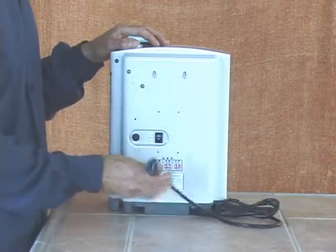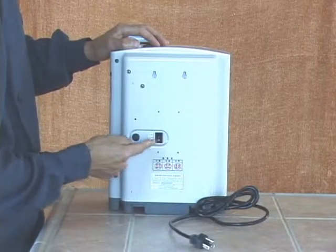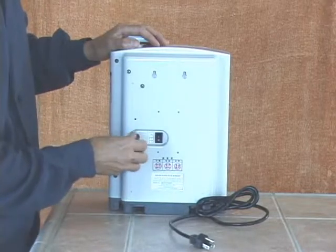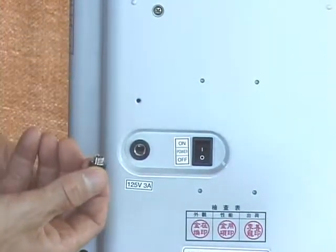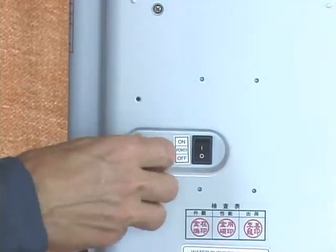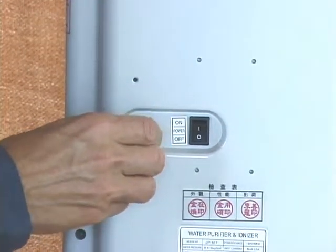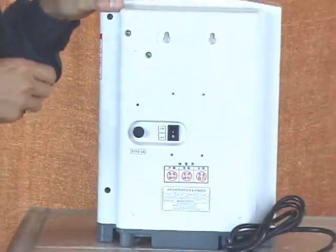What do you do if you need to replace the fuse? The plastic bag with the reagent kit came with an extra fuse. To replace it, unplug the power source and turn the machine off using the on/off switch on the back. Unscrew the fuse housing to access the old fuse, gently remove it, insert the new fuse, and re-thread the housing. Tighten it down firmly but don't over-tighten. Then plug the machine back in, power it up, and resume drinking your ionized water.